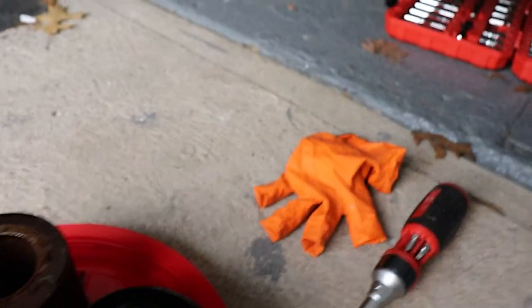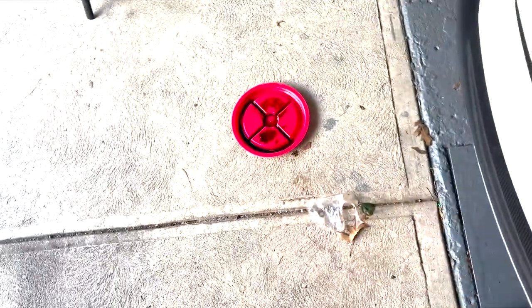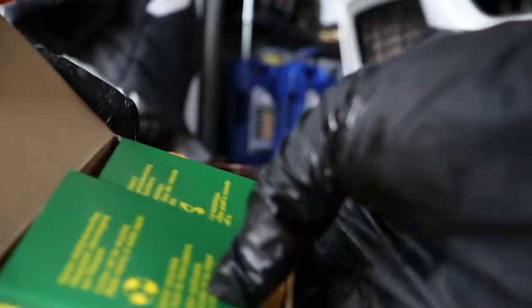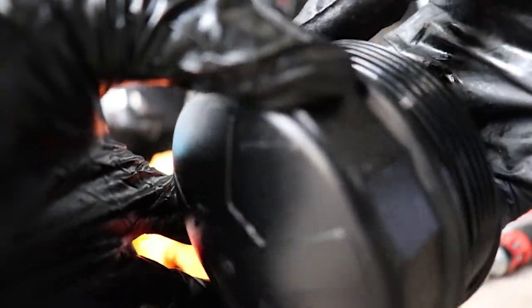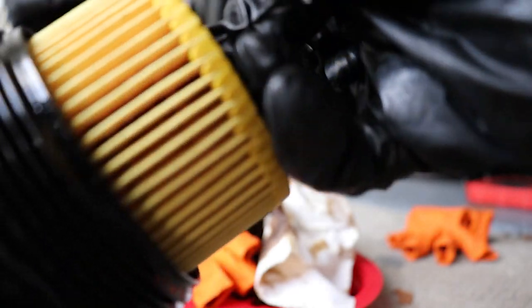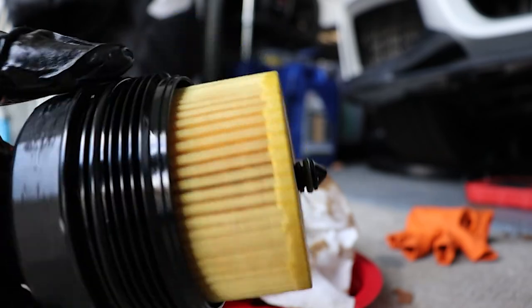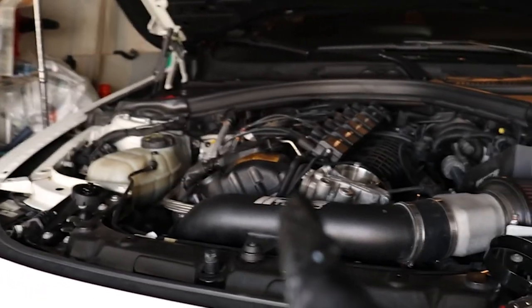Let me grab the new oil filter. We want to clean this up first — we don't want any old oil or mixed oil solution in there. Grab some paper towels and also make sure to clean out the inside of the oil filter housing; it's good practice to clean both during a change. The oil filter comes with our gaskets and an extra washer for the bolt. There's really only one slot for the gasket, so shove that in there, get the last little gasket on top with your fingers, and it's on there — not cracked, looking good. Oil filter is set.